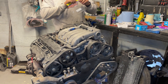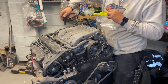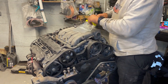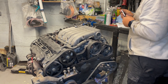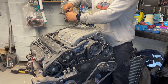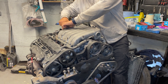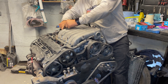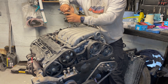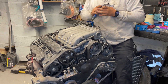Get your ziploc bag, open it up, and as you're taking the bolts out just throw them in the bag and label it 'plenum' so you know where they came from. We'll also take the plug bracket off — tie it down to the engine and pull it all back. Another technique: if you remove something like brackets, put the bolts back in the holes they came from. It saves the hassle of figuring out what bolt went where later when you come to put it all back together.